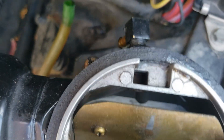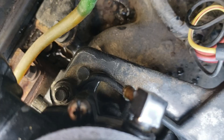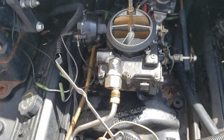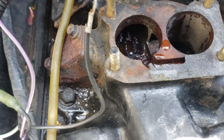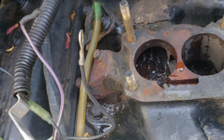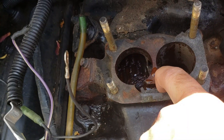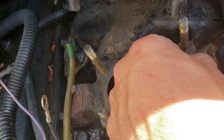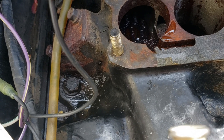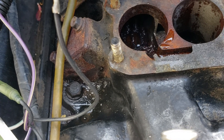There's one more back there. We're going to get those four off of there — I ain't never going to get that carburetor inside. So a couple things: when you take this off, if it's been a while, there's going to be some gasket on it. Get something and scrape that gasket off, and make sure it's clean before the carburetor gets back on.